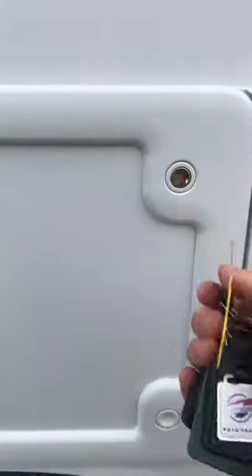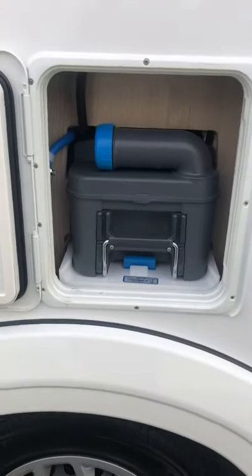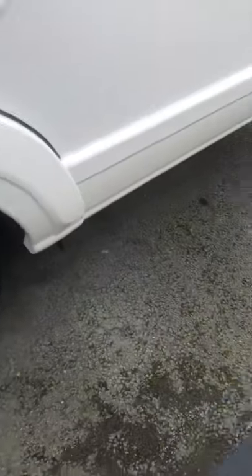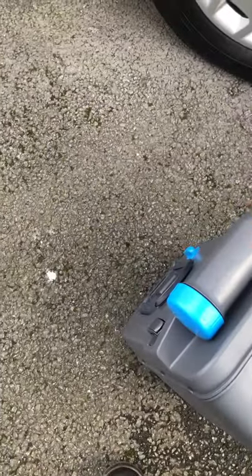Next along is your toilet cassette. To open this, use this key here. Open it and push both in at the same time. Your toilet cassette is there. To bring it out, lift up the blue bit here and your toilet cassette is out. You also have the handle just there to wheel it to the septic tank. To empty the cassette, pull this round screw and you can pour that away into the septic tank.